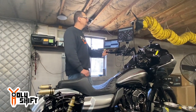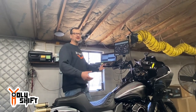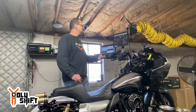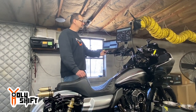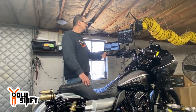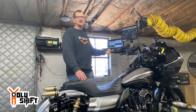So this is flashing to that amount of torque at that point in time. That's pretty wild. So is that what the bike is going to be putting out, you think? Not on a dyno sheet. Not loading it that way. A dyno sheet is kind of a record of what it's seen during that run, but it doesn't really show exactly what the bike's doing all the time. But it's a good comparison tool. That's really what it is. It's a tool for comparing, okay, how did this one react versus the other one, and what changes we made to show that. It's not 100% accurate.